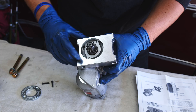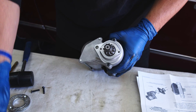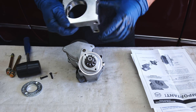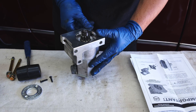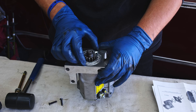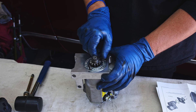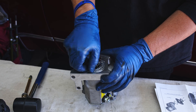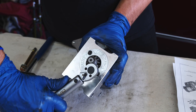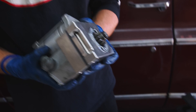One important thing to note: these marks are lined up with these holes so we know the orientation when we put it back on. We now have the block and ring removed. The included shim goes right there, and the block goes back on. The marks need to be aligned — it wasn't like that at first, so use a rubber mallet to seat it fully. Install the ring. Power Master recommends blue Loctite on these two ring bolts for final installation, but since we aren't sure the clearances will be correct yet, we won't Loctite them now. Grab your inch-pounds torque wrench, set it to 50 inch-pounds, and torque those bolts alternating little by little until you hear the click.